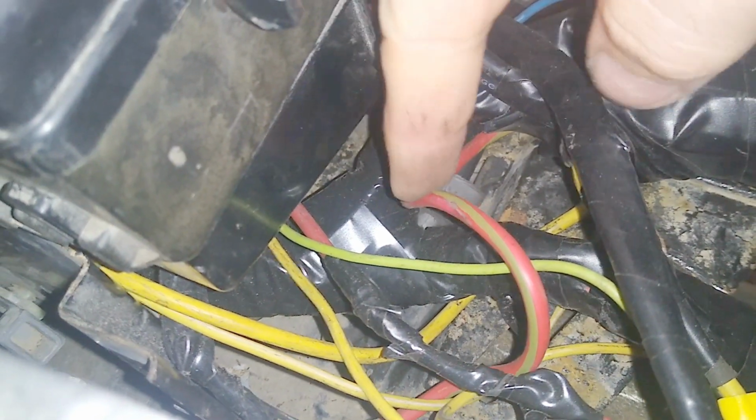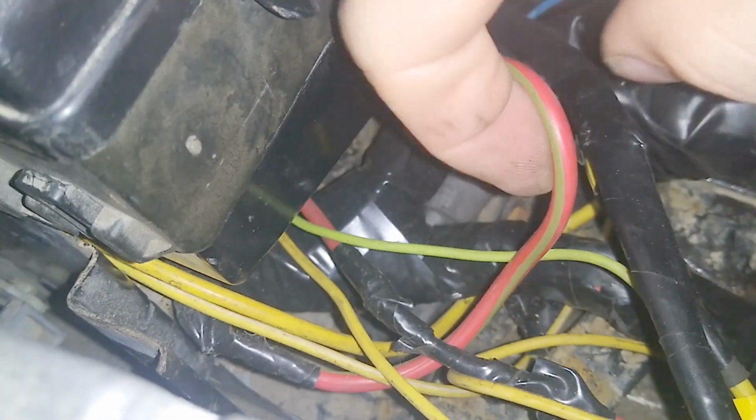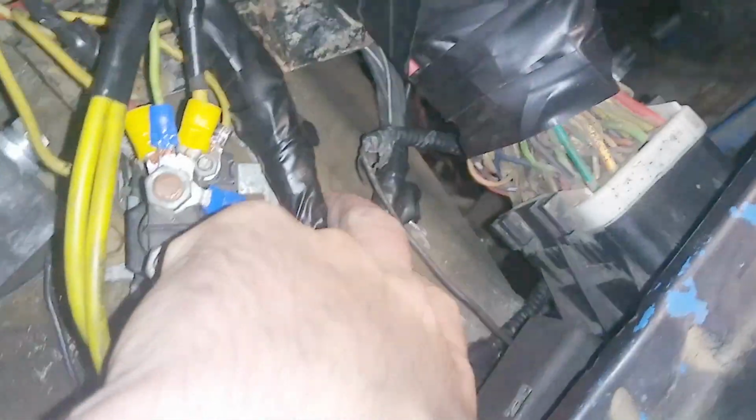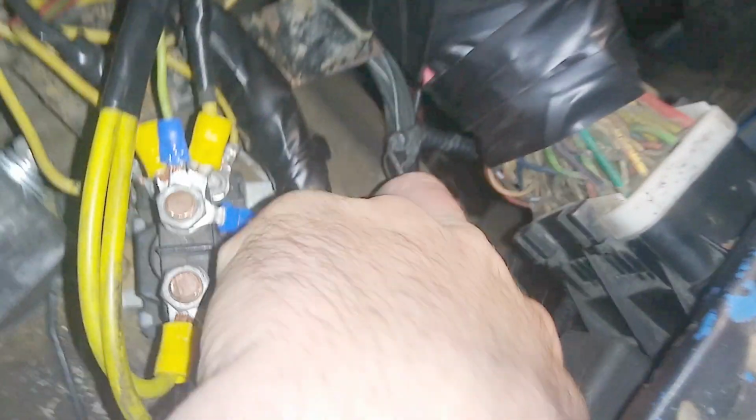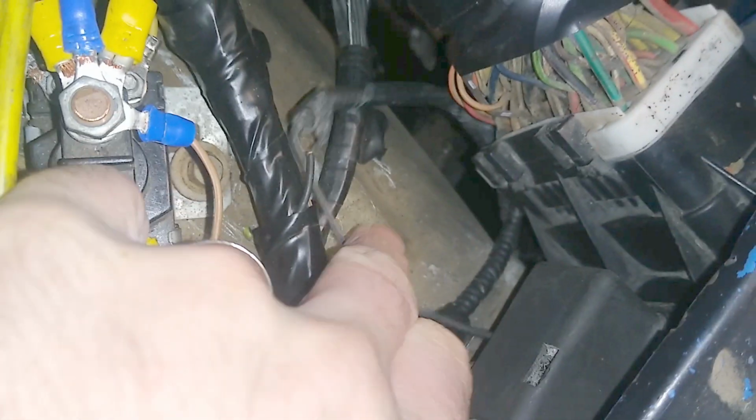If you pull apart the fuse box and take a look at fuse 22, you'll see a big red-green striped wire coming from it. This wire will need to be wired to your keyed ignition source. If you notice the large pile of black wires that are spliced together, this is your harness ground. Keep those grounds in the harness and be sure to ground them to a good ground. Also, keep the PCM ground that comes directly off the PCM.